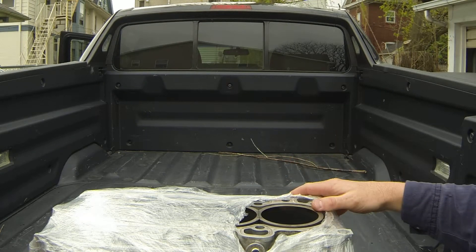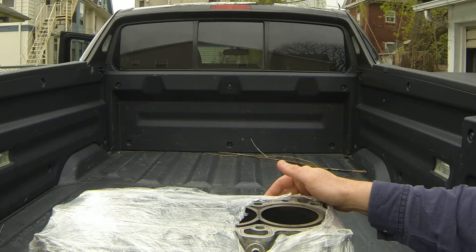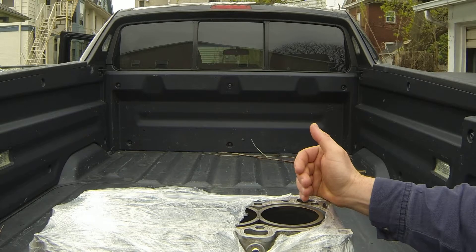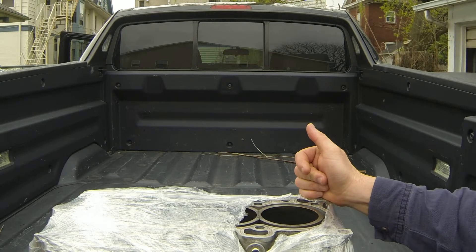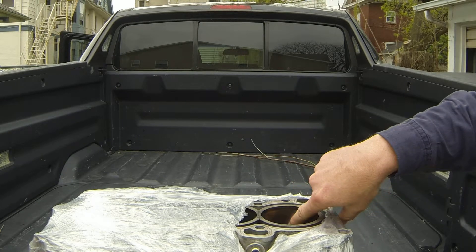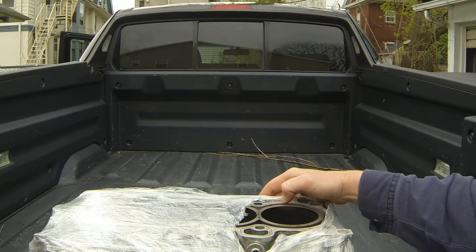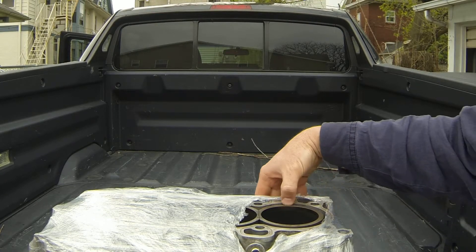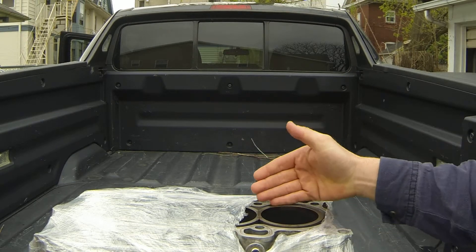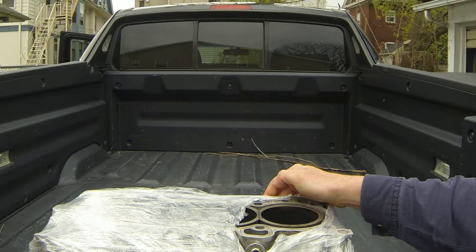It's odd because I ran this motor for a long time like this. I even did a leak down test on it a while ago for a completely unrelated issue and I had only 5% leak down, which is really good on a motor like this. You can still see the crosshatch marks on the side walls. It's between 1.5 and 2 thousandths out of round, so that's only 7.5 tenths on each side.